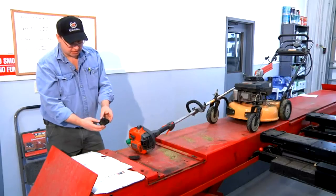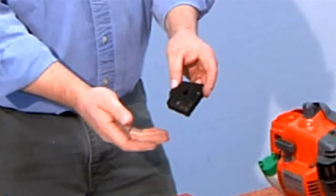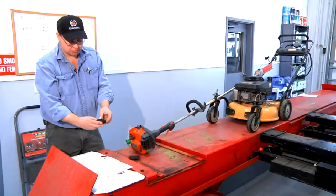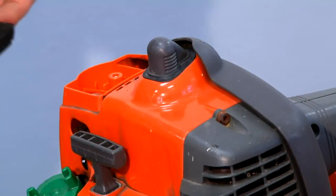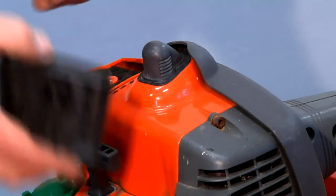The way to clean it is to wash it out with a solution to take the oil out of the filter. You would then reinstall filter oil back into the filter, squeeze out the excess, and then install it back in the engine. If this was your culprit, your engine would then start.